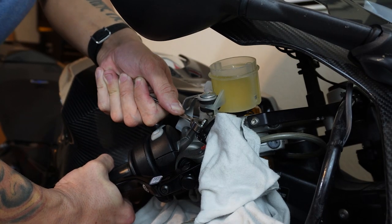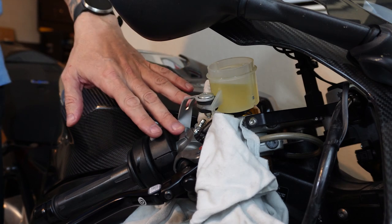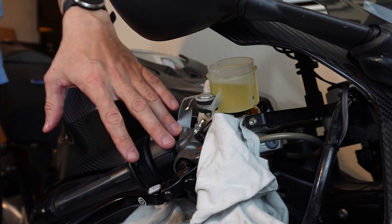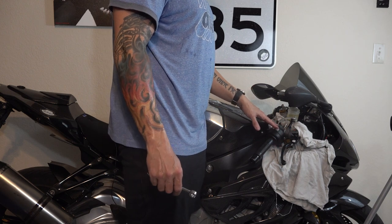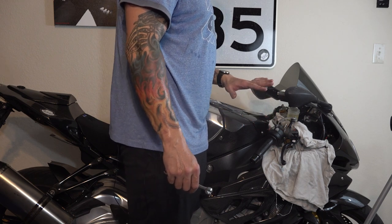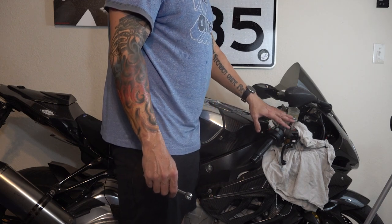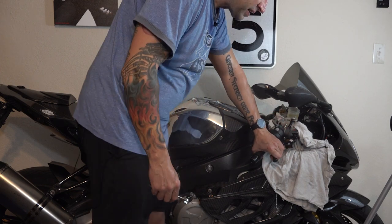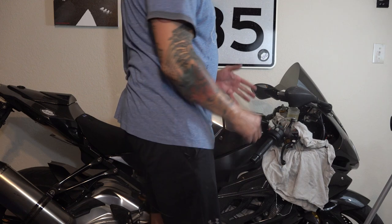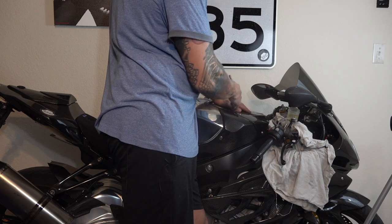Just go in and make sure to tighten the valve before you ever start letting that lever out again. I've got everything bled out just up here, but I have not done the calipers yet — I've tried to keep the air contained up here. The safe thing to do is to go do the calipers next, and I'll put a link to the video below in the description that tells how to bleed your brakes. I've got a video that already goes all the way through that, including cycling of your ABS pumps with the GS 911 tool. What I'm going to do now is put a zip tie around the lever and hold it there overnight, then go ride it. Once it's settled in, I'll go through and do a full brake bleed properly, like shown in the video in the description below.